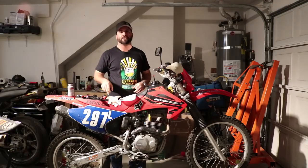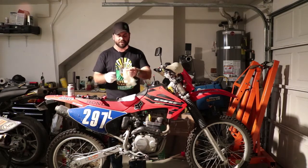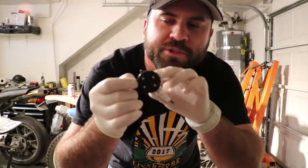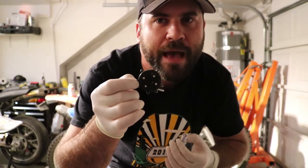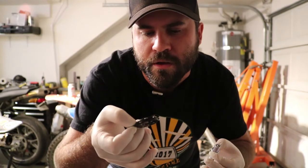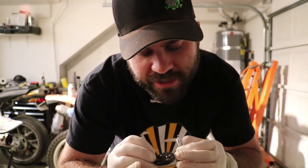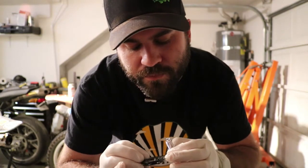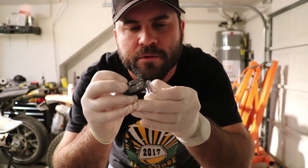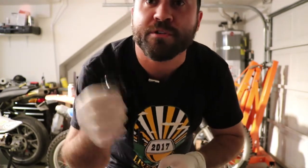Before I handle the new spark plug, I'm going to glove up because the oils on your skin can create hot spots on the porcelain. This thing is your spark plug feeler gauge — each of these wires has a specific thickness, and you can check that against the acceptable gap on your plug. Honda's plug, I want to say they allow for 0.031 inches to 0.038 inches. I've got a 0.030, a 0.032, a 0.035, and a 0.040. That 0.032 should fit just between the electrode and the ground with minimal interference, and it happens to. The 0.040 doesn't fit, and there's a little bit of play between the 0.030. So we know the spark plug is gapped correctly.